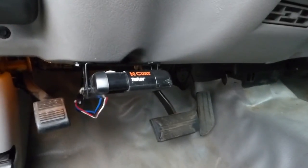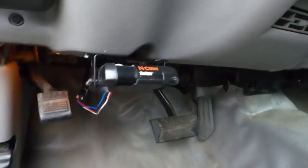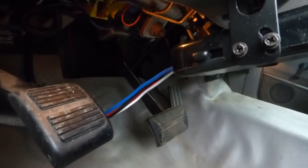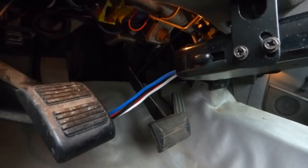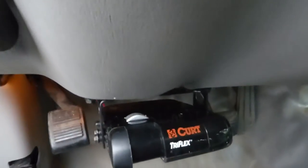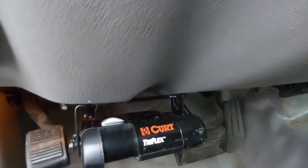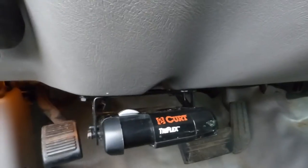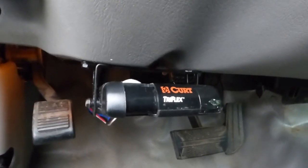You really need to plug a trailer into it, which I don't have at the moment, to go any further and recalibrate. It's got a little switch on the side for sensitivity — right now it's on low-sensitive. If you move the switch in the other direction, it'll apply the brakes more aggressively. There's also a little wheel on top for fine-tuning; the scale is 0 to 100 and it says to start at 20. We'll find out more about that later.